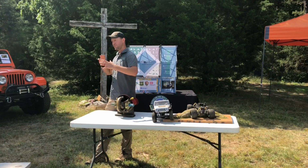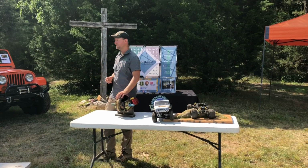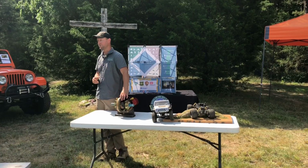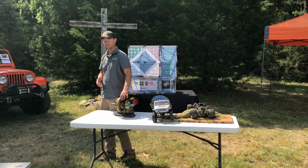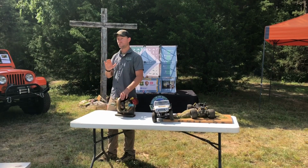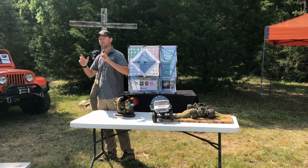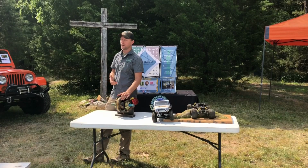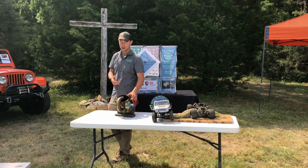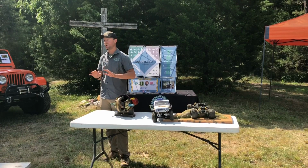So it's slack, engage. Kind of like if I'm walking up a muddy hill and I'm stomping up the hill, probably I'm gonna fall. Same concept, so if we're stomping on that throttle or manipulating that throttle, our tires are stomping on the hill. So they're breaking loose, and that's how we create a spin situation, and we lose our traction. So with that 2-foot driving on an automatic, we can maintain that traction.